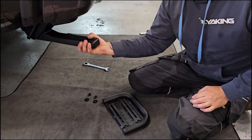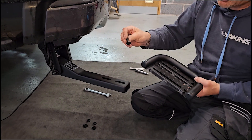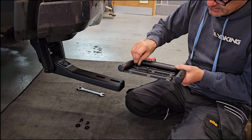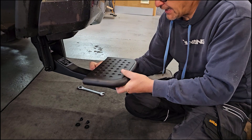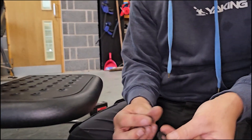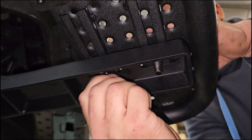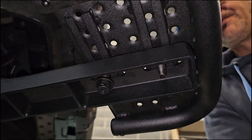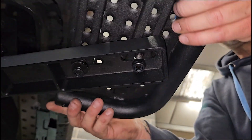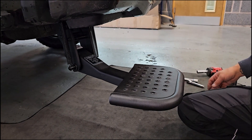The mechanism is now fitted — you can see how it folds up and down. We've got our step plate here, and that mounts into these two holes. Very simple: the two coach bolts with the square head slide into there on the underside of the tread plate. Sit that onto here, put those bolts through the two slotted holes, and then we've got the remaining nylock nuts and washers — 17mm head, M10s I believe — and fit those underneath. You've got plenty of room to change the angle of this tread plate.